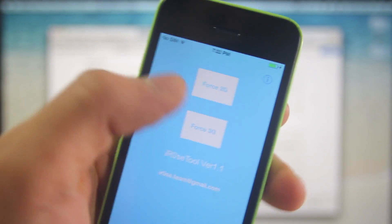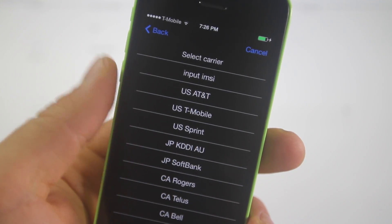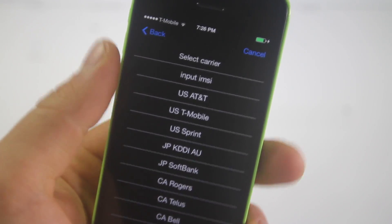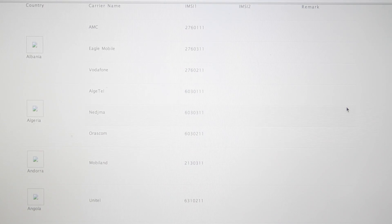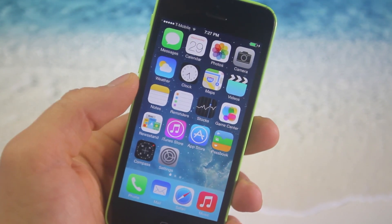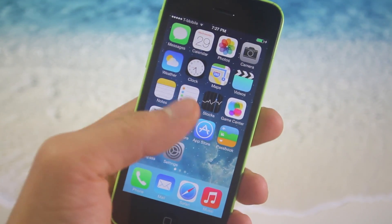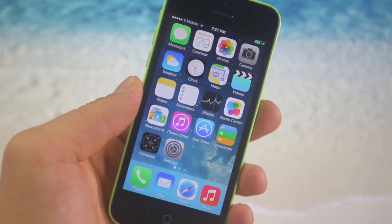Most of you guys won't be swapping between phones, so this is really not what you need. But I do have to show this to the people that are having this problem. Now, when you get to the programming part and you don't see your carrier listed, all you need to do is select 'Input IMSI' and visit this website — it'll give you a list of all the IMSI codes for carriers that may not be listed on that menu.